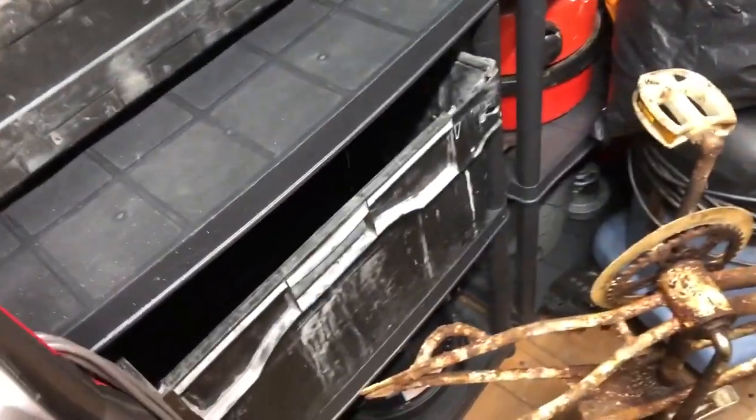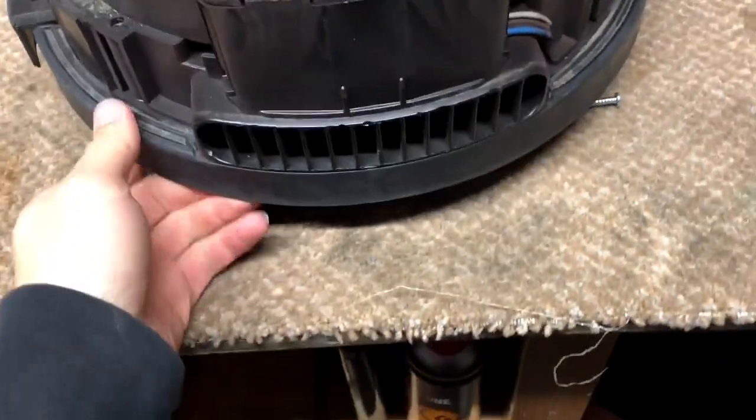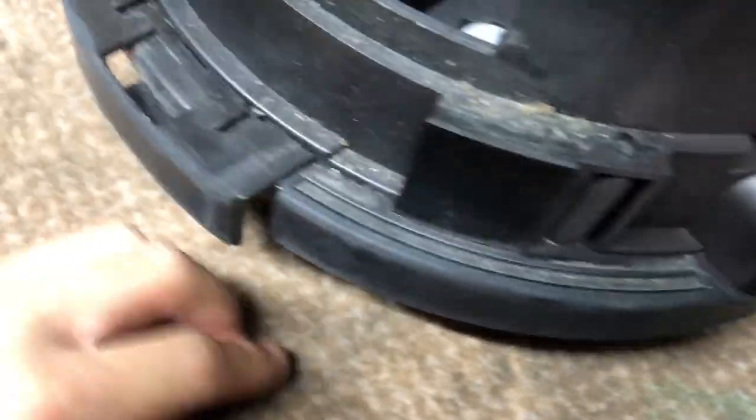Once you turn the top of your Henry over, make sure you don't lose any screws, and just literally lift off the top cover — that won't be needed. The rewind cassette will lift straight out — that won't be needed either, so you can put that to the side. All that will be needed is this part here. There are screws that are falling out, so just put them somewhere to keep them safe.